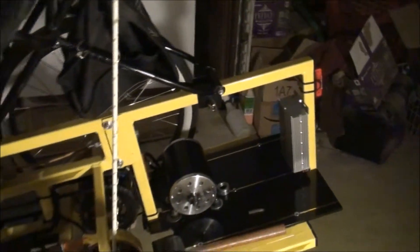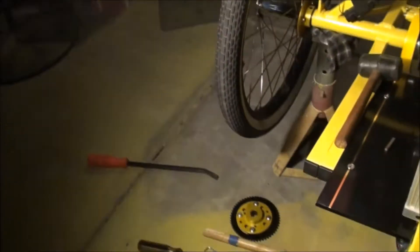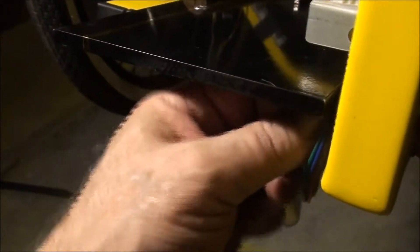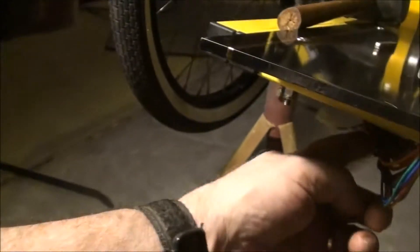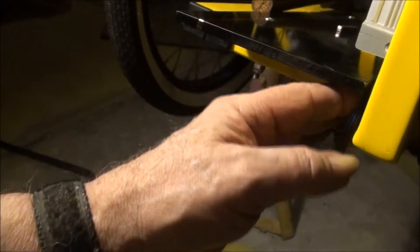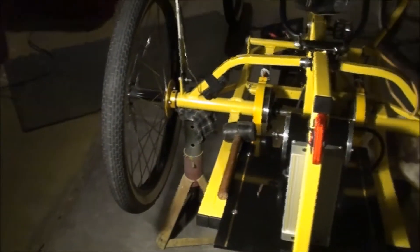So there we have it. I was looking around on the bike and I do remember when I laid the wires for the throttle, it went in between this motor plate and the frame here. Now I can move these wires around — I don't feel anything that's tight that would cause chafing — but I'm going to go ahead and unplug the wires underneath, undo the strap, pull the wires out, and inspect them. Make sure I don't have any chafing.